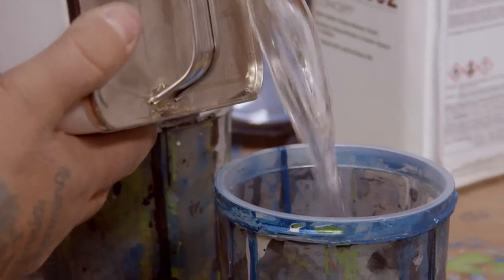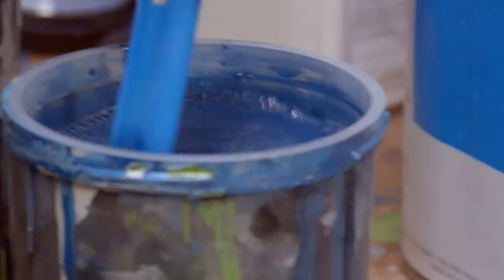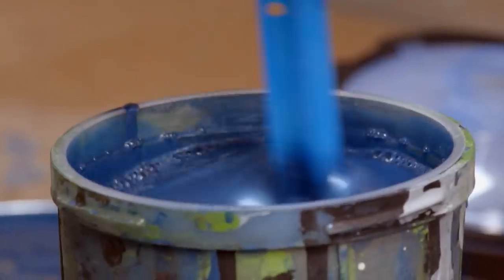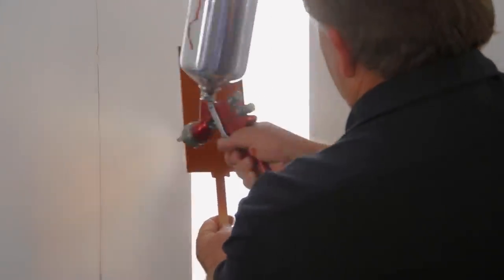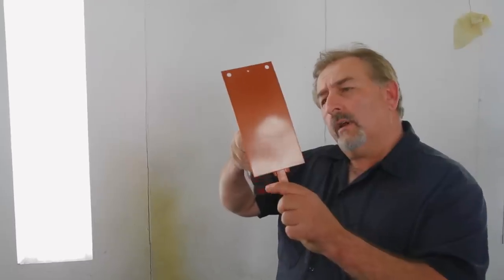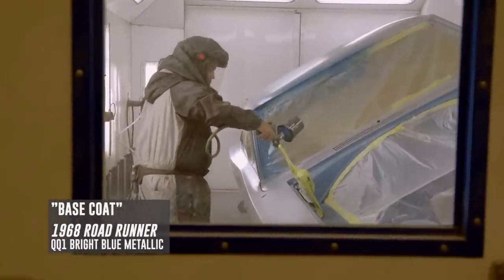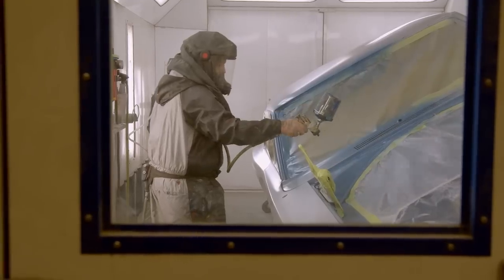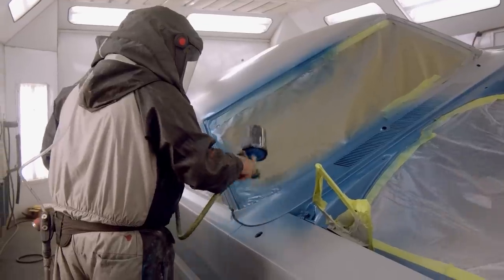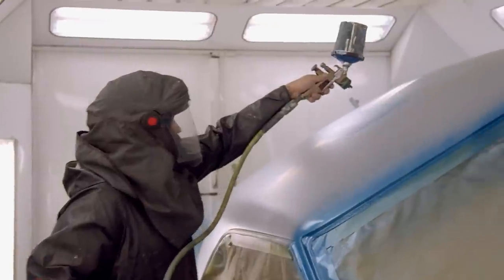That QQ1 is a very bright blue metallic — pretty color, a little darker than V5. Without pre-paint you don't just throw a couple coats on and call it done. I've noticed blues and greens take seven to eight coats to get complete coverage, so I have to go back to doing spray-out cards. You do the card in four different base variations, hold it up to a light until you can't see through it — that tells you exactly how many coats you need on the car. Because you've sealed it, you know you don't have any sand scratches, pinholes, or imperfections. Put in seven or eight coats, let it dry completely, then you're ready to clear.